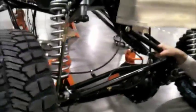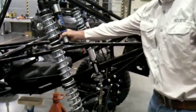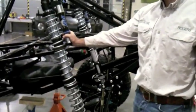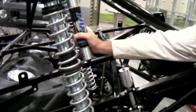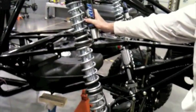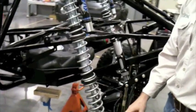We're getting a lot of comments on these shocks — can you describe these for us? These shocks are an amazing evolution of shock technology. If you go back about 10 to 15 years, people running in races like the Rally Fighter is set up for would get to a shock stop, pull out the top rings, and dump four sets of red-hot shocks on the ground. Now you can run a full 1,000-mile race with these shocks and continue to drive them. This is called an internal bypass, external reservoir, coilover, 2.5-inch shock made by Fox suspension.